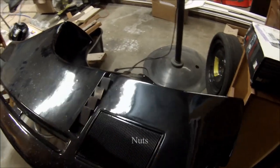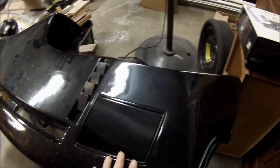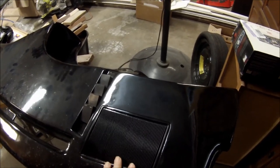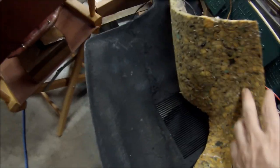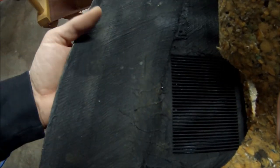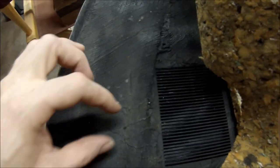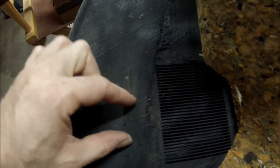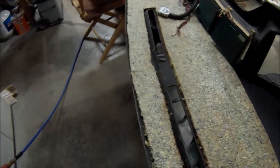On my dashes I just cut it out for you and then you epoxy them in. This one I actually fiberglassed over — I originally put Bondo on it and the Bondo started to crack a little bit and the speaker grill started coming out of place. So I put it back in place, put some tape on the other side, and fiberglassed over that little lip. If you use Bondo with reinforced fiberglass it shouldn't crack.